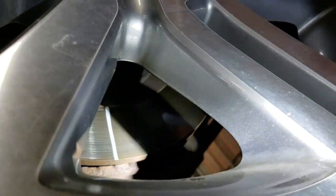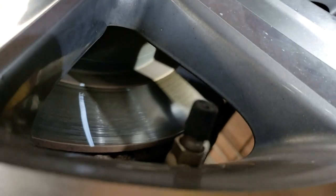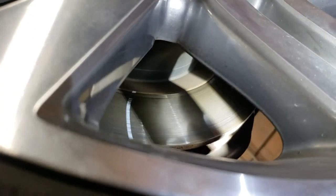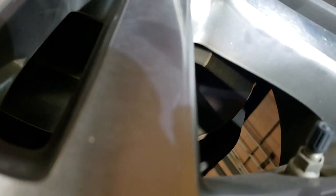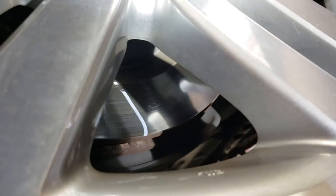On the front of the vehicle, we've done the same thing — painted a line straight across the rotor. On this line, we're only touching about the inner 10% and not even contacting the outer. As we rotate around, we're only contacting the inner edge, barely contacting the outer, and leaving the middle of the paint completely untouched. That tells us these front rotors got way hot and as a result aren't getting good surface contact. On the other side, the inner edge of the paint is gone, but the majority of the outer is still completely intact.